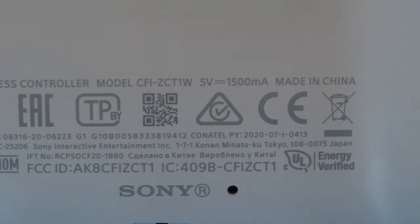So we want to find a phone charger that is very similar to that. The most important part is the 5 volts — most fast chargers are 9 volts, and that could damage your controller. If we have anything under 1.5 amps, it's going to draw battery life from the controller because it's not getting enough power from the wall outlet. The amperage can be higher than 1.5 amps, but it shouldn't be lower.